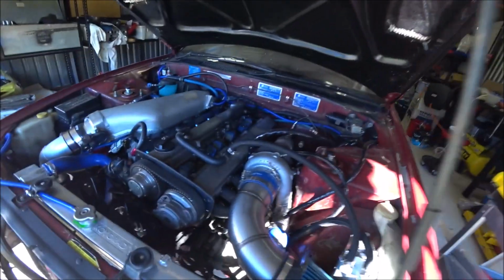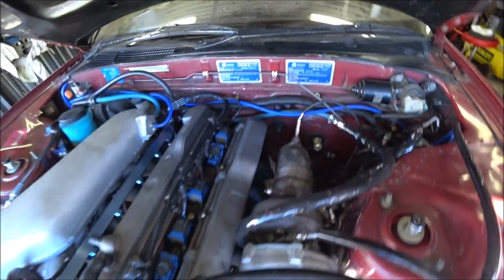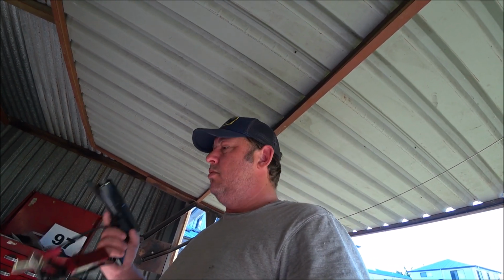I suppose it will, because it goes off the spark when the actual timing is firing, so I guess it will show it. Another suggestion was, if the miss is on a single cylinder, which I haven't determined, or if it's just missing on all of them when I try to build the revs, you get an infrared thermometer, not like this, like the one I have over there somewhere in the back of this garage. Place is a mess again. Point it at each exhaust port and see which one, if any, are running at a lower temperature, because that'll indicate there's the miss. Because there's not clean combustion, so it's just not burning. Therefore, it's not going to have the temperature of the others. So we'll see about that. But for starters, we'll just get the timing light on, see what we can see.